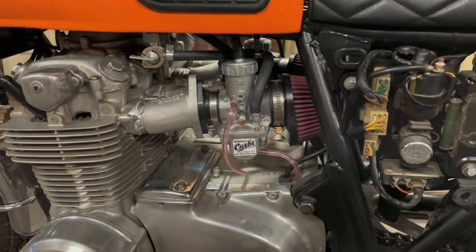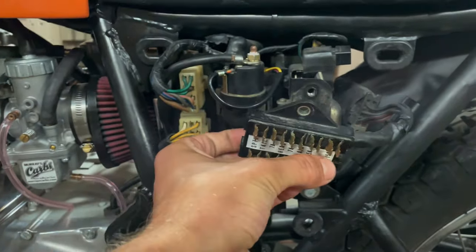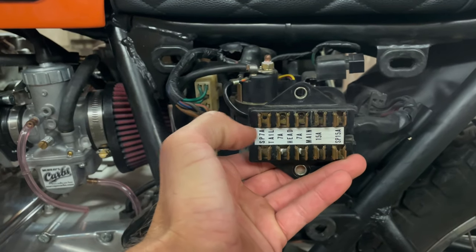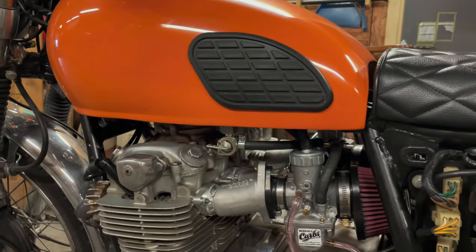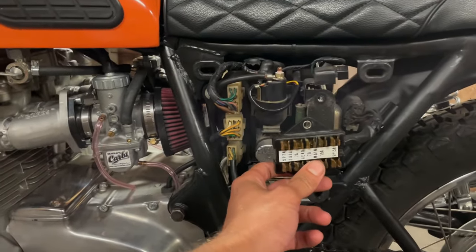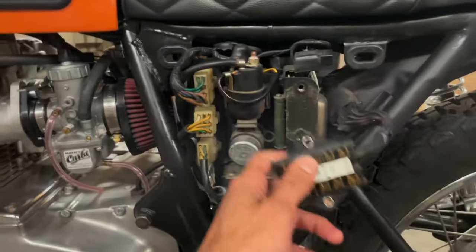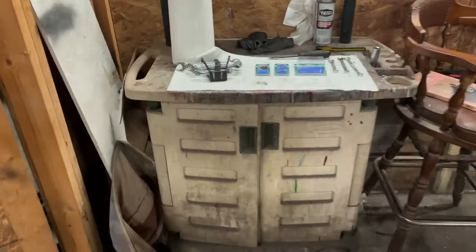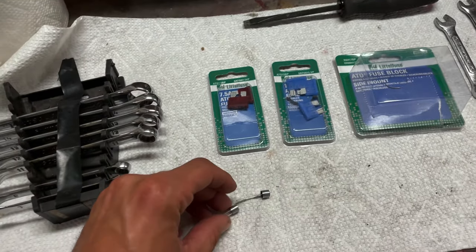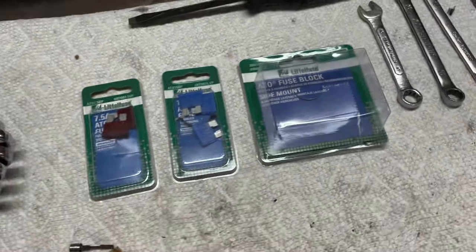The issue I'm going to be dealing with today is these old glass tube-style fuses. There's a spare 7.5 and spare 15 on this side, then a 7-amp for the taillight, 7-amp for the headlight, and a 15-amp main fuse. One day while riding, the lights were flickering and not really coming on. I had that same issue yesterday — the gauge lights were flickering and it was cutting in and out. I pulled over, pulled the main fuse out, and it just fell apart. I had the same problem that other time too — I'd just jiggled the fuse and it started working again. Yesterday when I pulled it out it fell completely apart.